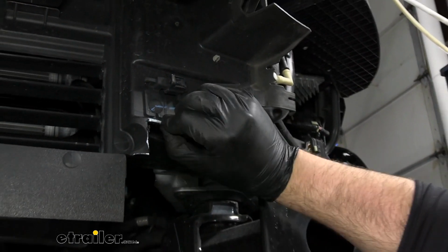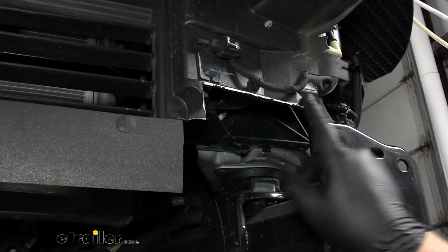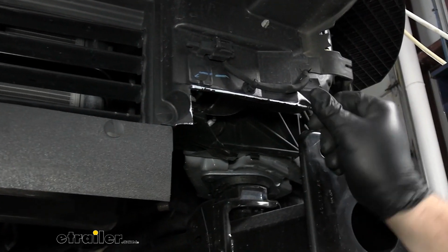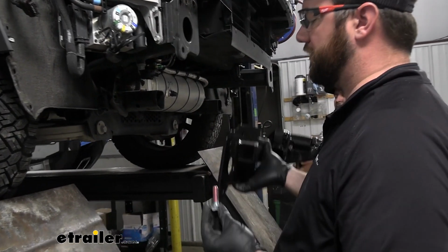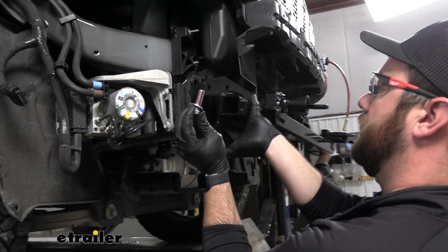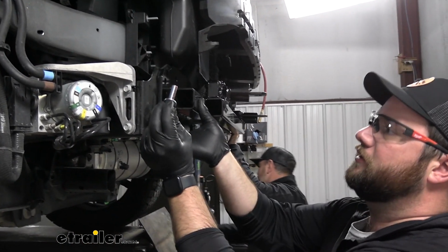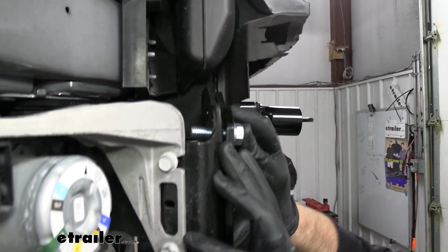We'll just take either your fingers, or you can take a knife or a file to smooth out these pieces of plastic. We could take our 1/2-inch bolts and our base plate, put one of the smaller flat washers on, lift our base plate up into place. It's definitely helpful to have a friend help you out with this.